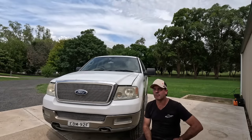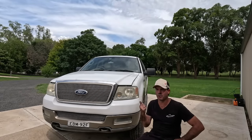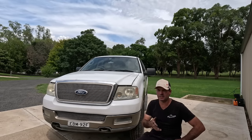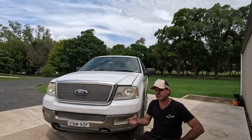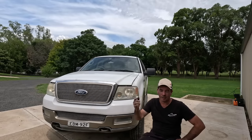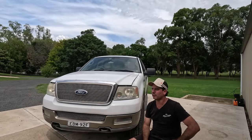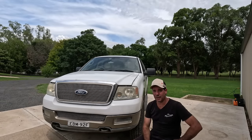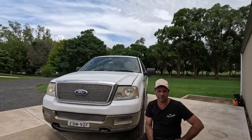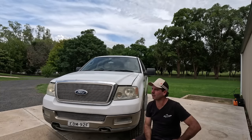And that's a bit of a weight off my mind, because I was thinking I did need to reprogram that with a tuner or something to get rid of the VCT check engine light to then take it out of failsafe. But just finding that fuse, hey, I'm not going to sing the praises of modern cars just yet, but that little scan tool did make it very easy to head down the correct path really quickly. That didn't take a lot of time.